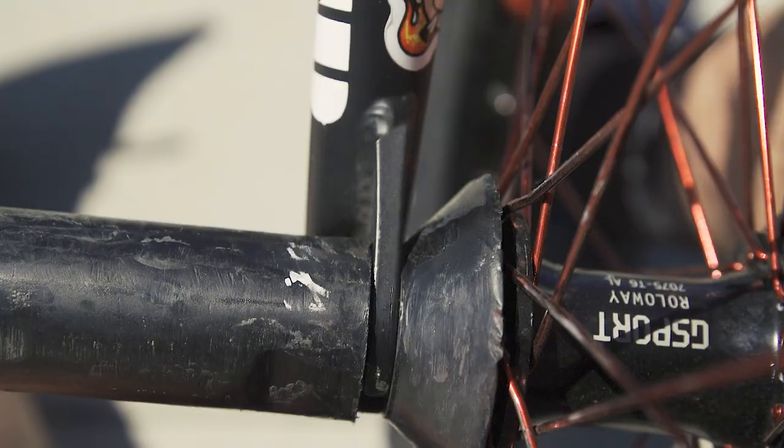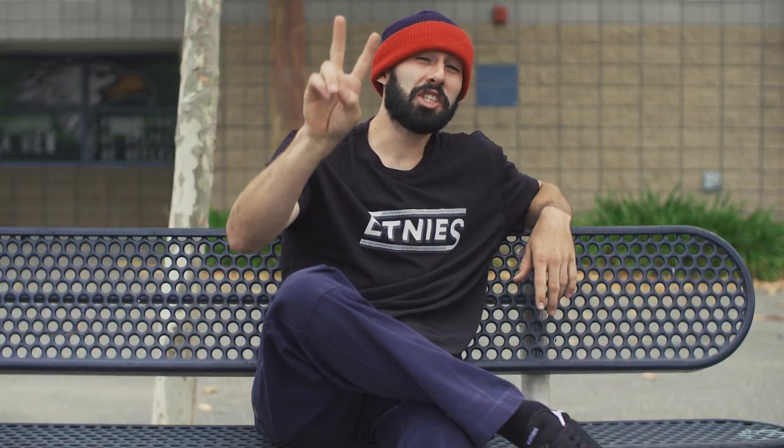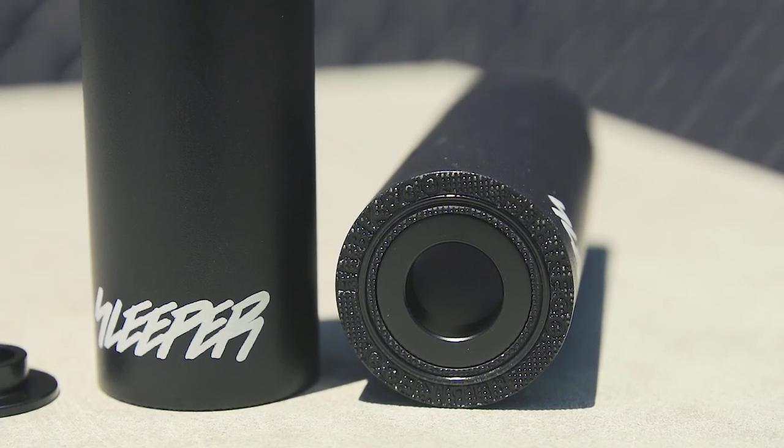On the side of the peg that touches your bike, it sandwiches your frame real tight. A lot of pegs start to get loosey-goosey, move around. The sleeve gets blown — no one likes a blown sleeve. I've done two things to prevent that. The first thing: we put some knurling on the inside of the peg for extra grip.